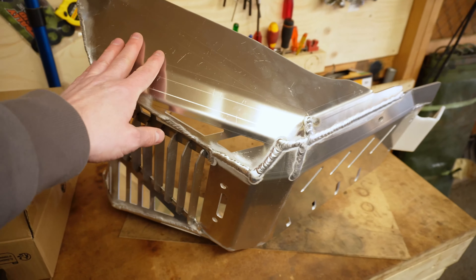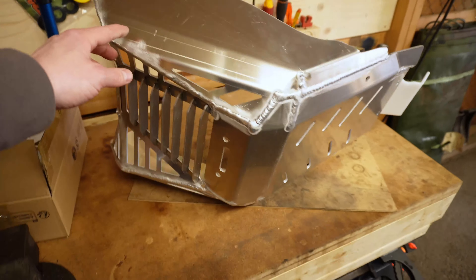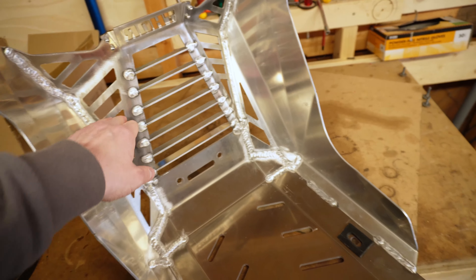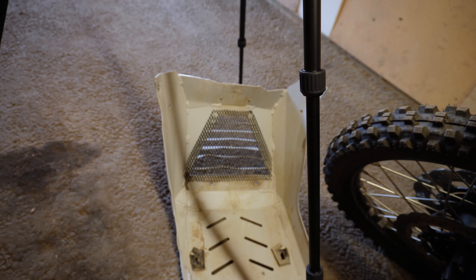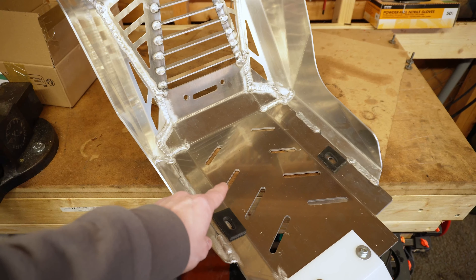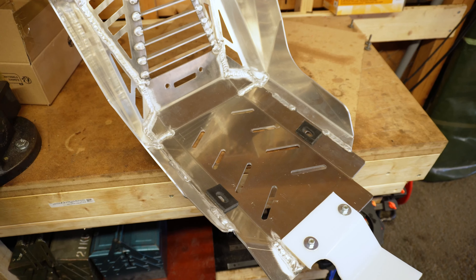This is the plain version — bare aluminium, not sanded or treated. You also have a black option and I think one more. There are a few things I'll do before I put it on the bike: I'll put a mesh here. I did that on the old skid plate. The mesh prevents big rocks and gravel from gravel roads from getting under the belly of the motor, where they could hit a big rock underneath and crack the oil pan.